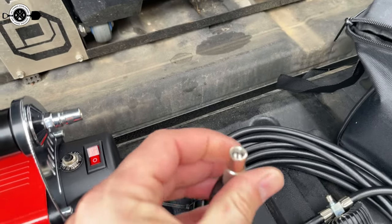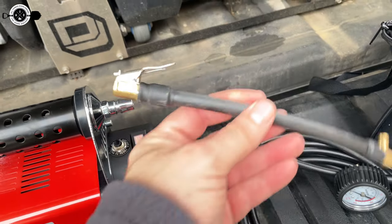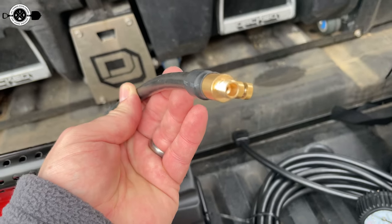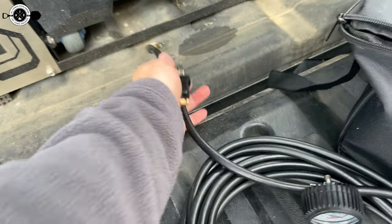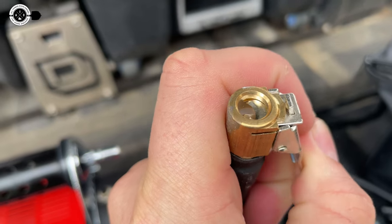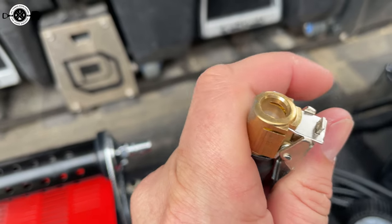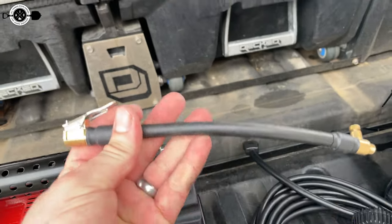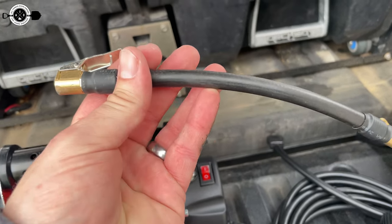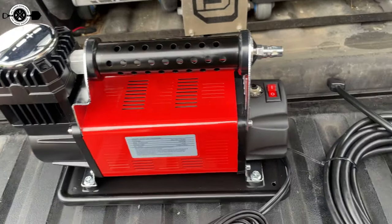As you can see, this thing you have to literally screw it onto each tire as you go around the vehicle. So that's going to be a huge pain and not something I want to deal with. I learned about these quick-release chucks when I had my VIAIR 88P — I'll put a link in the description below. Basically, it screws into the end of this and then it's got a quick-release chuck built right into the end. Within a second you can have this thing attached to a tire and be airing up, and then within a second pull it back off and move it to the next tire. It's like seven bucks, very inexpensive — an awesome modification. I'm going to do this to every single air compressor I get for the rest of my life because this thing is a game changer.